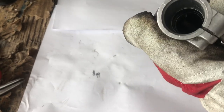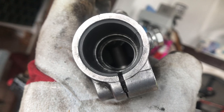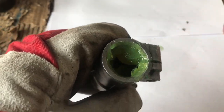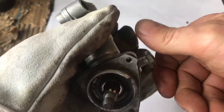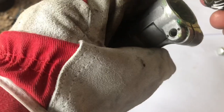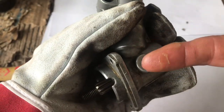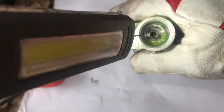So now down here we can pack that all full of grease before we put the next bearing in. Let me just go and pack that full of grease. Okay, down there — we're going to pack that all full of grease now. I've put loads in there, and the good thing is when I push this bearing back down there, that's going to squeeze all that grease up around there. So we need to make sure that this is loose or off. Then when we push this back down here, put this in here like that. Push that down — you see that grease has started to come up, so we know that's pretty much full. Now look — we can put that circlip in, make sure that's seated properly, and then we can put some more grease in and pack that with more grease.